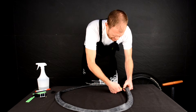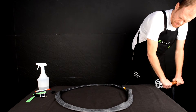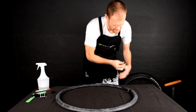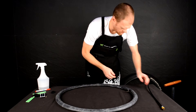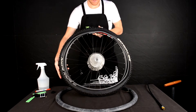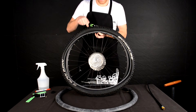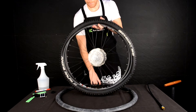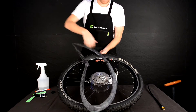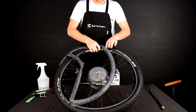Partially inflate the tire before placing it back on the wheel. When replacing the tire, ensure that the direction arrows are pointing the correct way. Starting at the valve stem, gently place the tube back on the rim under the tire.